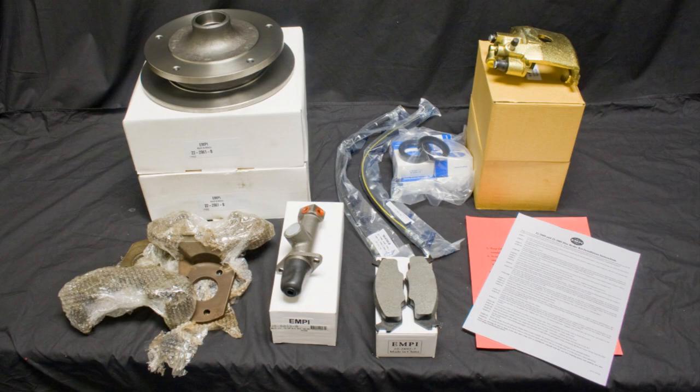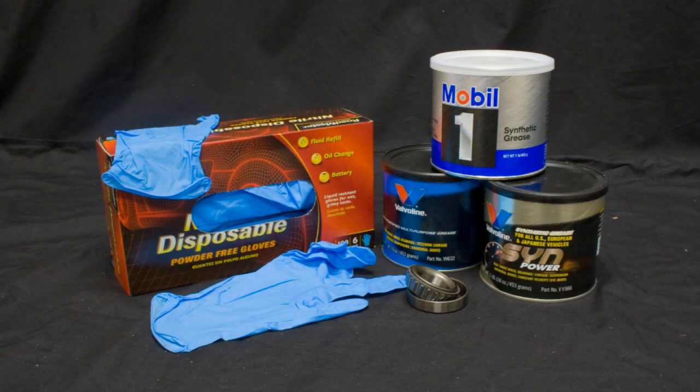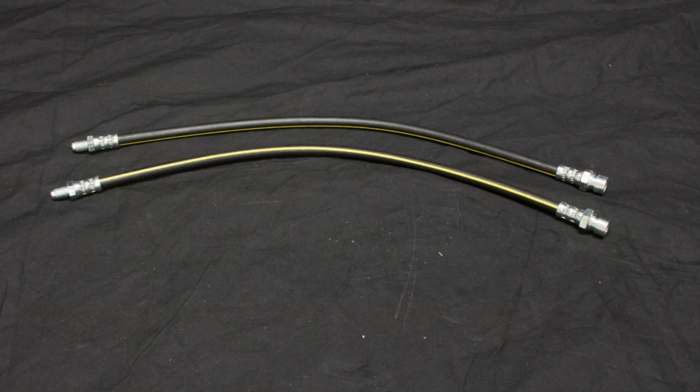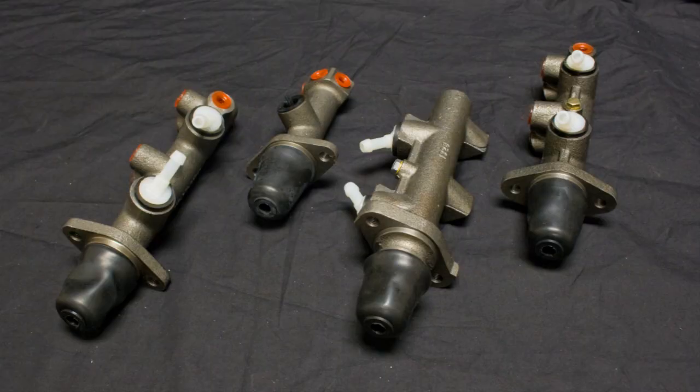Open the box and separate all of the components, read the instructions thoroughly, then go back and check that all the components are there and gather anything else that may be required before you begin your installation. You will be installing new wheel bearings and seals, so you will need a fresh can of grease — natural or synthetic is your choice, but one that is made for disc brakes. Your kit may have come with new brake lines; if not, now is the time to change them. Same with your spindle nuts — check them over for damage or cracks and replace them if necessary. Make your choice and have all the required components ready before you begin your install.